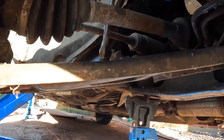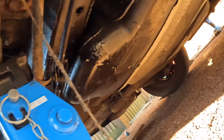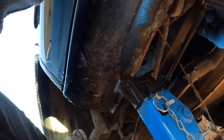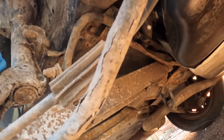The only place that feels rough — I filled it with fluid, pumped it up, and it's squirting out from behind the fuel tank. This straight section here goes into the tank, just behind the tank, and it comes out back there somewhere that's easy to get to. At least it's a straight bit that's fairly easy to get to. I'm going to have to put the car back on the ground and move it forwards because I can't work with it in this spot. At least I can actually roll it around now — I've cleared out all the rat's nests.